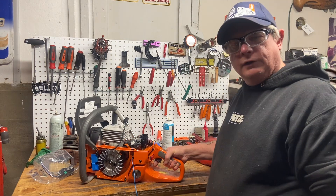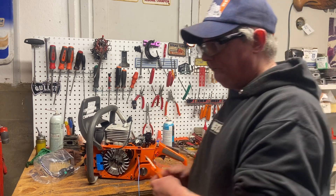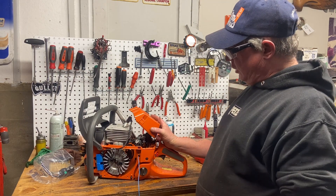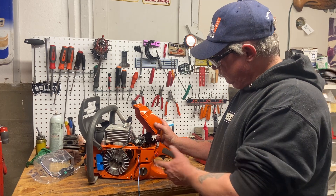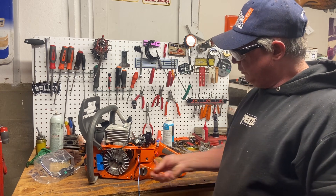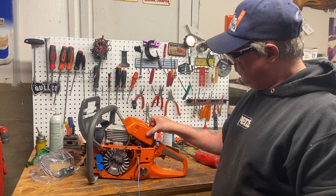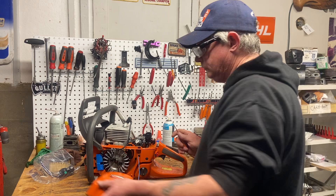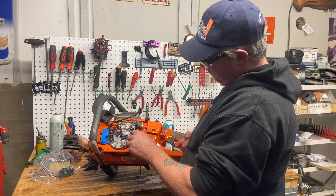If you don't agree with that, here's something to try: when you adjust the carburetor on an adjustable carburetor with a non-rev-limiter ignition — let's say you set it at 13,500 RPM with the cover off — then put the top cover on and run it again, it goes to 13,700. It gives it more RPM. Try it out if you don't believe me. All the forced air comes up through this tube here.